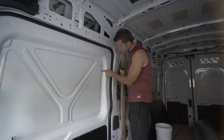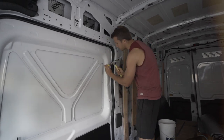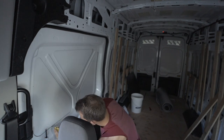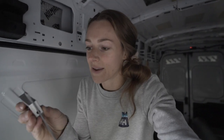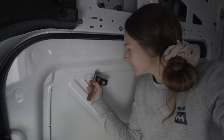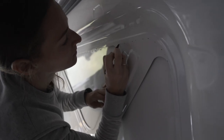On our first van we used a drill and drilled along the inner line template and then traced all the drill holes from the outside. But it's pretty time consuming, so we found this technique online using just an awl and a hammer — you just go around the outside every couple inches and tap all the way along. Up here the metal is quite thick so you can't use the awl to puncture through, so I'm using a little tool to measure the distance between the cutout and the ridge on the perimeter, then mark it along and do some pilot holes for a reference point on the other side.